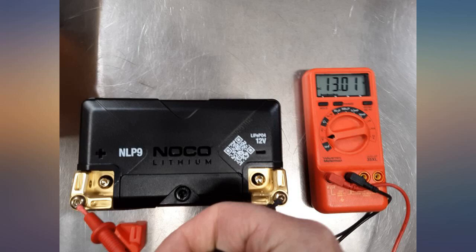The difference of this battery from others at the same price is the amazing amount of cranking amps — higher compression bikes need all they can get. Batteries with 200CA wear out faster than the 400CA of the Noco. If this battery does what it says, it will be worth the extra cost. The battery can deliver a lot of amps, but the capacity seems small for the size; there must be a trade-off for high amps but low capacity.